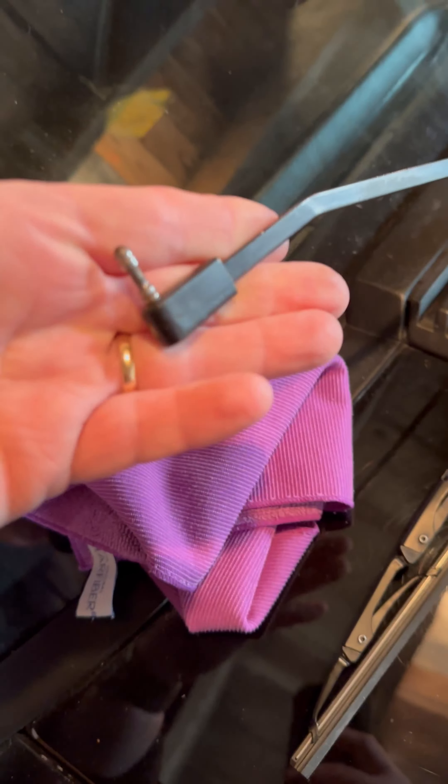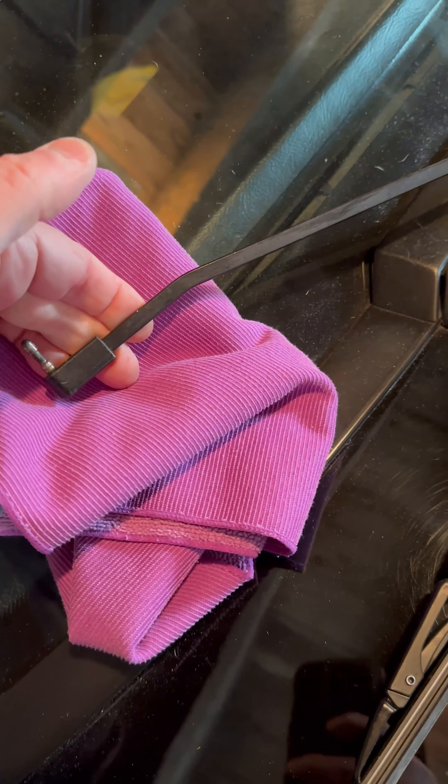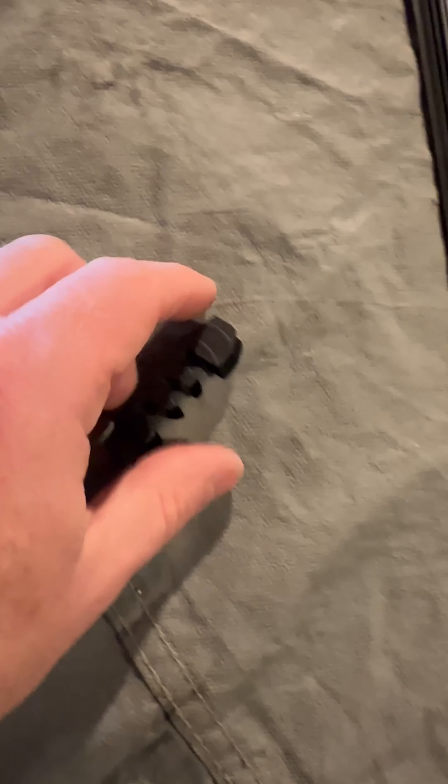Now that I know I have the right blade and I want to take the old one off, I'm just going to take a quick glance at what I'm doing here. You might notice I have a rag down here. I've seen it happen more than once where somebody pops this off, it lifts up, they're trying to get it off, and then — whack — it hits the windshield and cracks it. So it's a nice tech tip: put down a towel before you start.